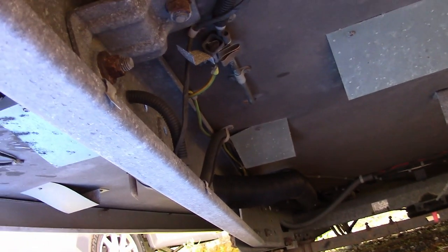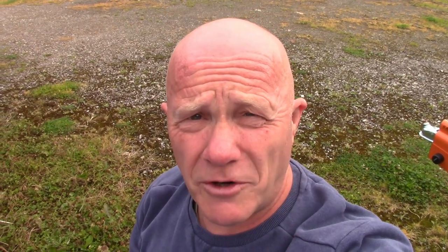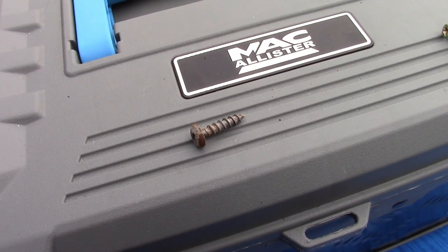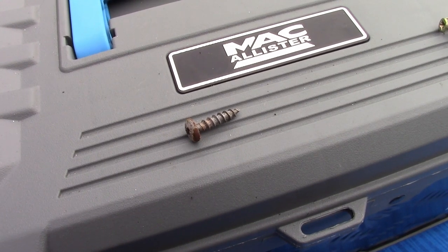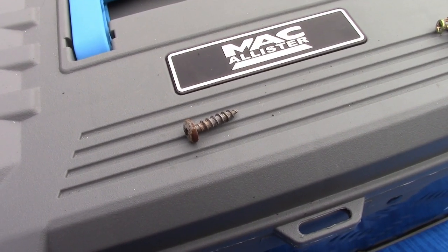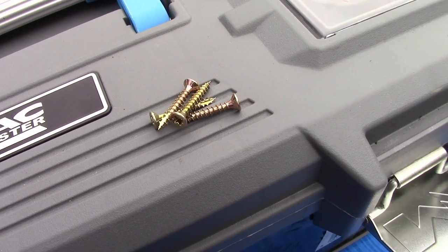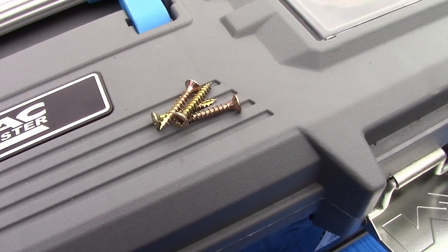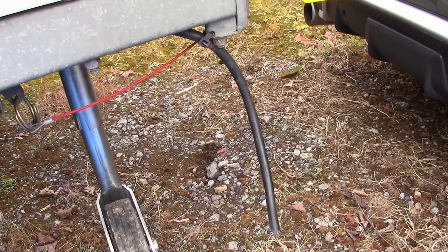It's probably going to be somewhere down there — I may do it at the back of that deflector. Somebody said why don't I put it into the front locker. I am going to look at that to see if it is easier. It will obviously be more waterproof — the box that I've got is waterproof. I wanted to check the length of screw put in the floor underneath from the manufacturer. I've got these screws which match in length — they've got a fast, wide thread so they will grip into the marine ply under the caravan.